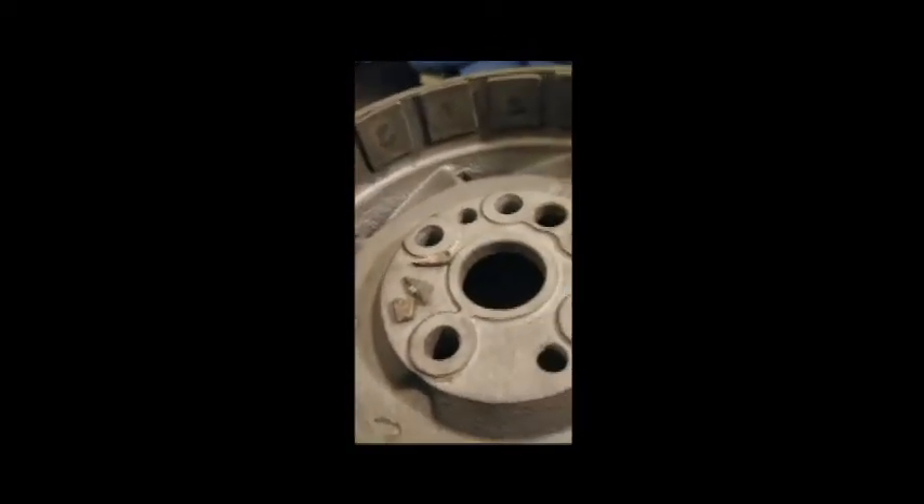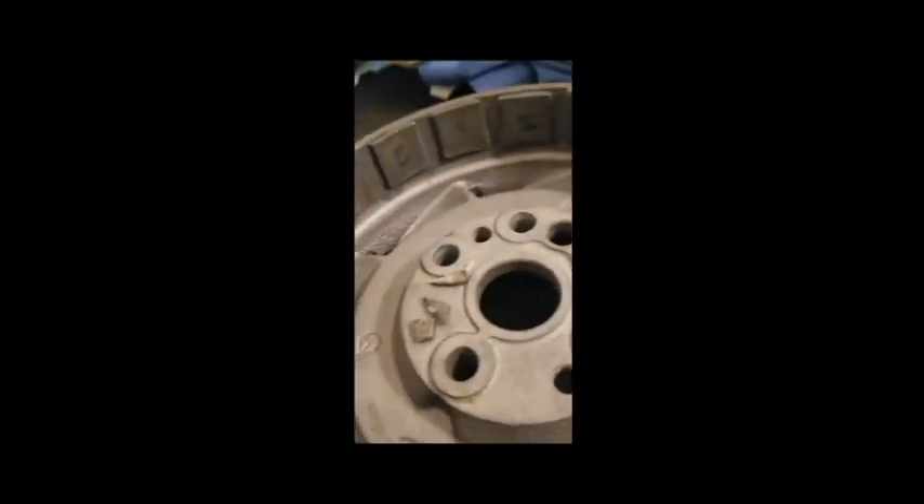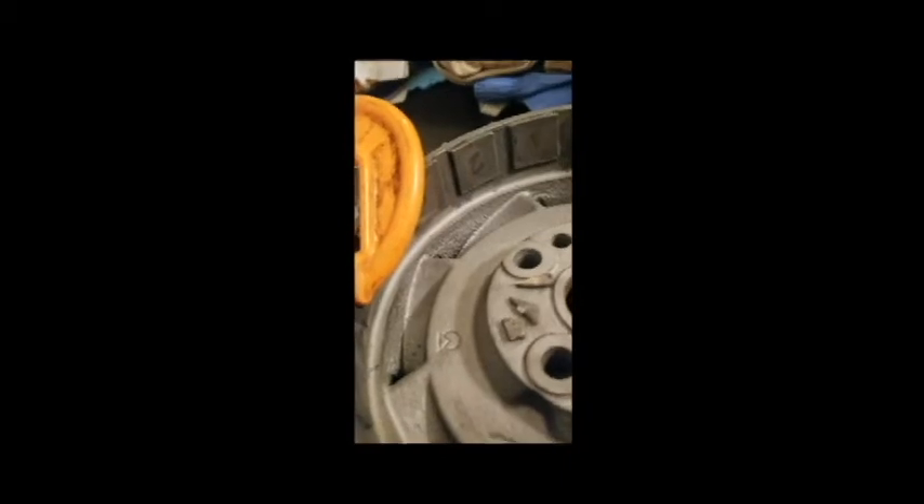I know motors running today on Mercury and Evinrude where we just epoxied back the magnets. It should be no different here, although there are quite a few magnets on the E-TEC stator. It did run — actually ran very well — and would just start dropping voltage once the magnets started shifting positions to a point where the capacitor couldn't recharge itself fast enough to provide adequate power to the ignition system and fuel injectors, and the engine would cut off or go into reduction mode.